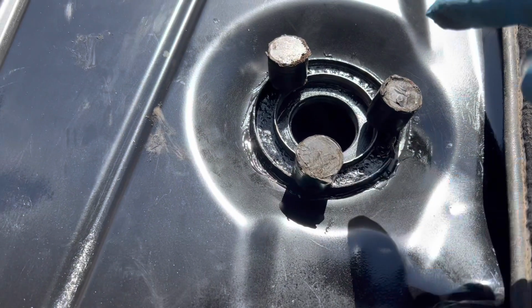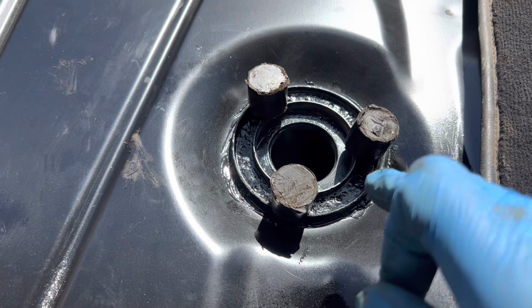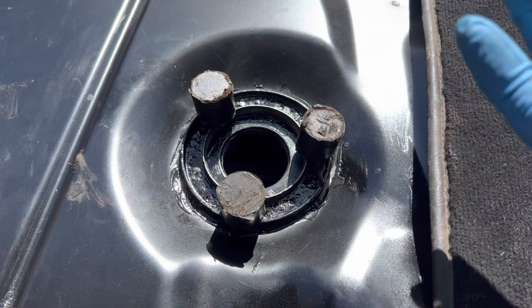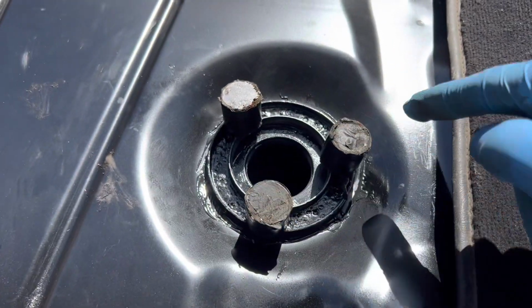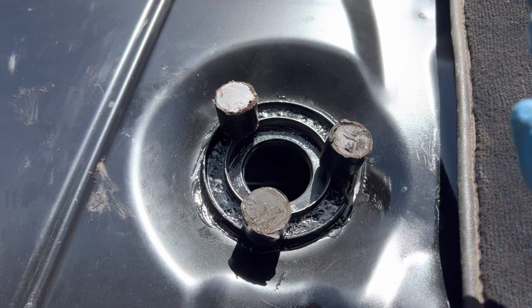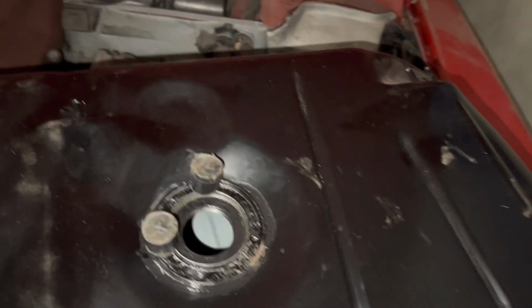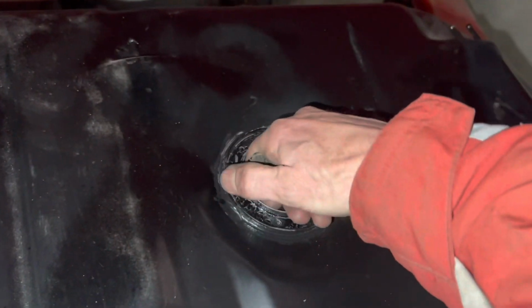You could simply just weld this ring on, but my experience of welding is that when you weld, you burn through the primer on the other side of the tank, and that's exactly where you'll get moisture from any air in the tank. So the advantage of panel bond is it gives you a waterproof seal, and you don't end up burning off any primer on the underside of the piece you're working on. It's the next day and this panel bond is dry. We've just got to make sure that we don't put these magnets together.